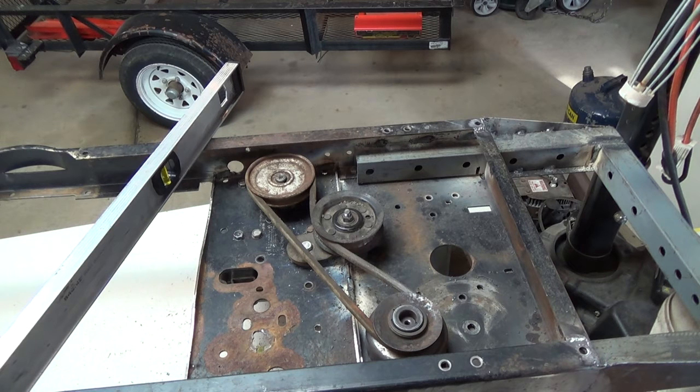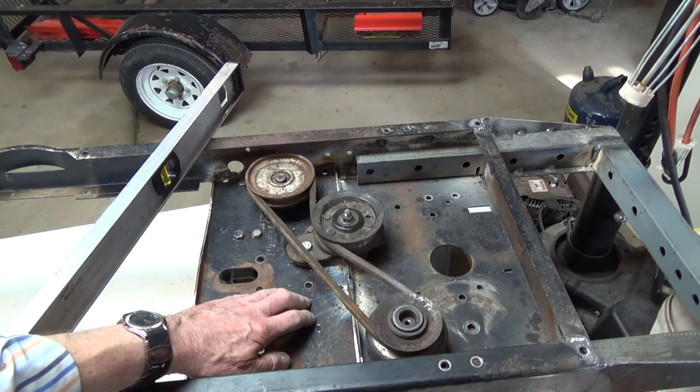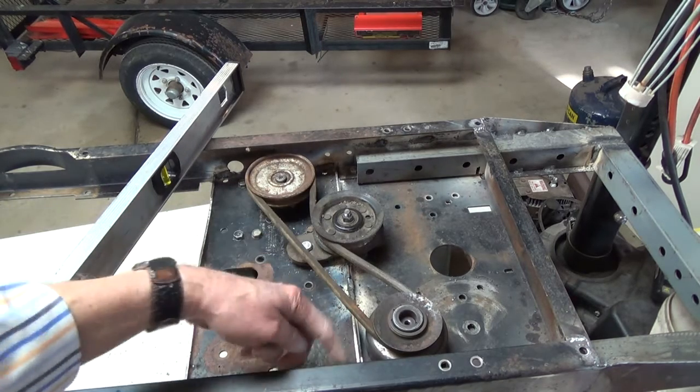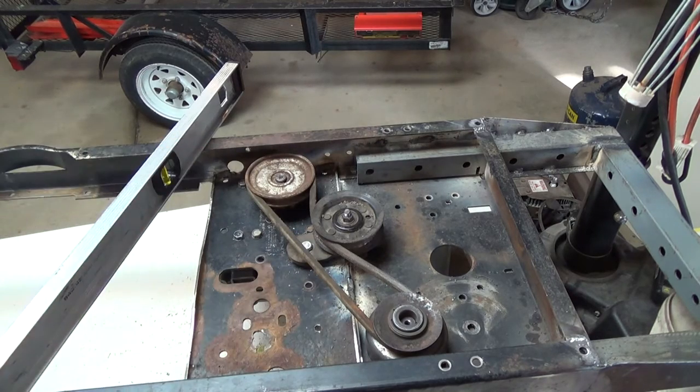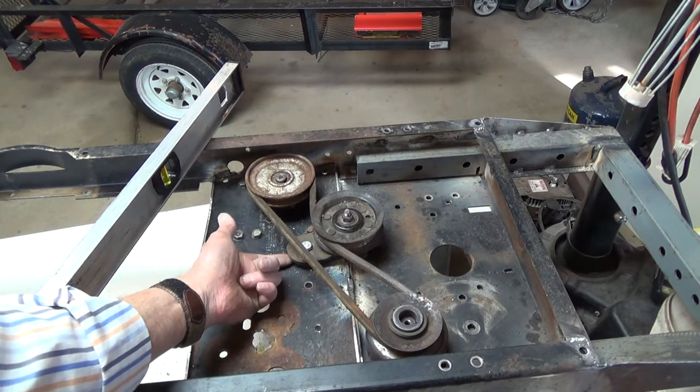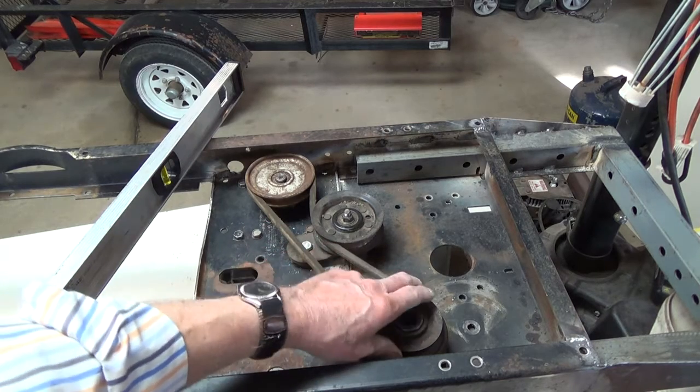So that's what it looks like on the bottom end. This plate here is all welded in — it's only tacked in, with three tacks on each side and a couple in here. And there's a spacer washer under here to get this to line up properly with our two pulleys.